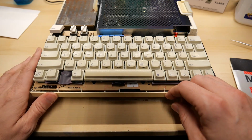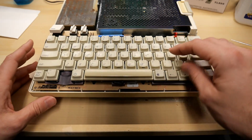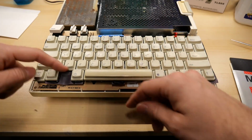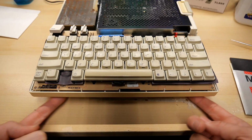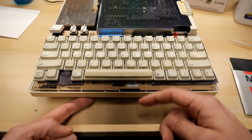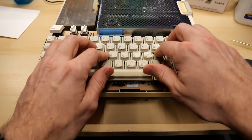just took this off entirely. I have a feeling that Apple added this as a spill prevention for the keyboard, because if you spilled some water just on the keyboard, it probably mostly will drain out along the bottom edge of the computer, which is just a vent right here. There's no PCB there, just the speaker in the middle. But it has a terrible side effect of just making everything feel really mushy.